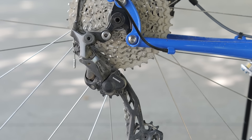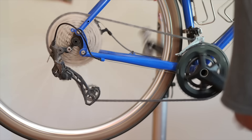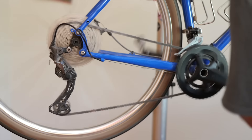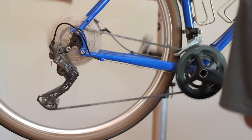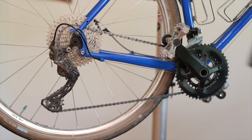For the first combination, the GRX 810 worked perfectly with the MicroShift 4630 crankset and 11-42 cassette — no hanger extenders needed. All you really have to do is play with chain length and make sure it works. Big-big was reliable, though you probably shouldn't spend a lot of time there. Small-small, the derailleur maintained tension fine, and notably the B-screw wasn't even screwed all the way in. Shifting worked flawlessly with no weird hacks — you just bolt it on. Easy 10 out of 10 recommendation, and this applies to 11-speed groupsets as well.